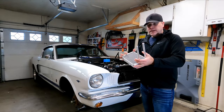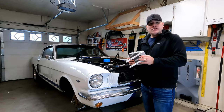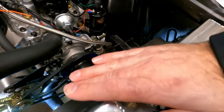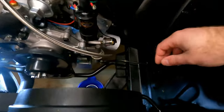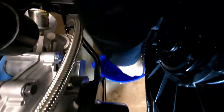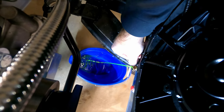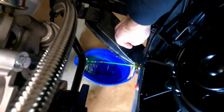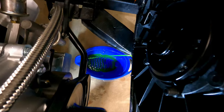So we're going to take this cap off to let the pressure off the system, then go down and twist this drain to let it leak out into the bucket. While we're waiting for that to drain, let's go ahead and get started working on the heater core box.